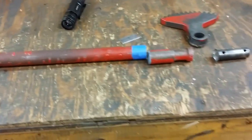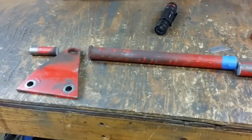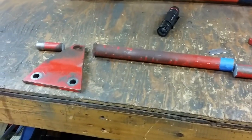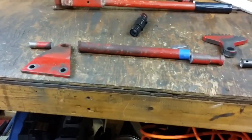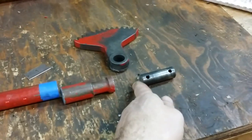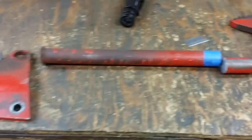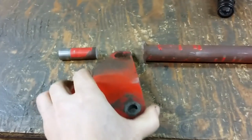This is totally craziness and really indicative of why in the mid to end of the 90s, Wheel Horse just couldn't keep up with the Chinese garden tractors being dumped on the market — because this cost them a hundred dollars a piece to make, which was completely ridiculous. If they had just used a piece of three-quarter inch bar stock, welded the gear on and be done with it, that would have saved costs. This isn't any stronger, since you neck it down for the frame, neck it down for the steering block, and then basically castrate it in the center for the foot peg bar clearance. I took the hacksaw, cut the weld, and was able to slide this off the three-quarter inch bar stock.